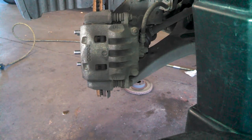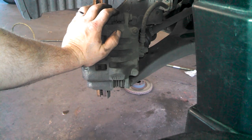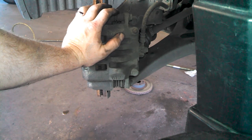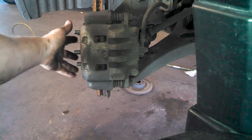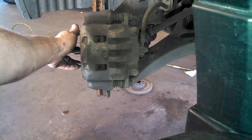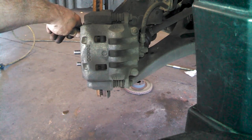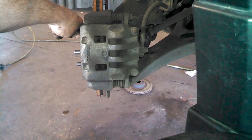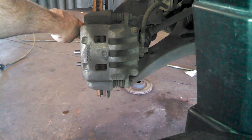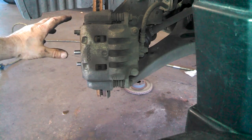2011 Subaru Outback. And we're going to remove and replace the left front wheel bearing hub assembly. 5 19 millimeter lug nuts. Break them loose on the ground with your wrench, then go ahead and jack up the vehicle as needed, and support it with safety stands. Protect yourself somehow so it does not fall on you, then jack it up and take the tire off.